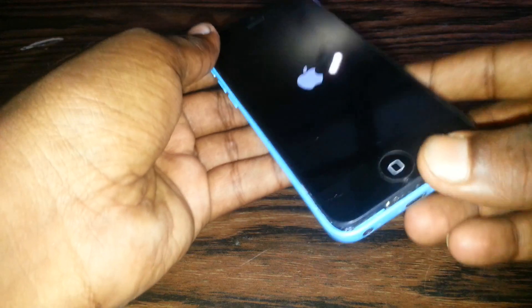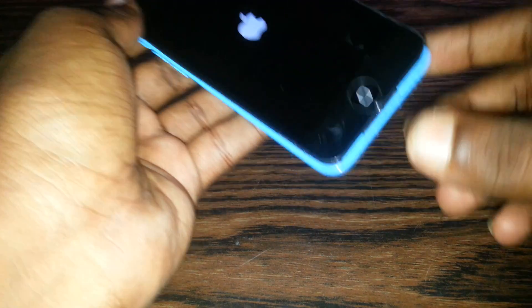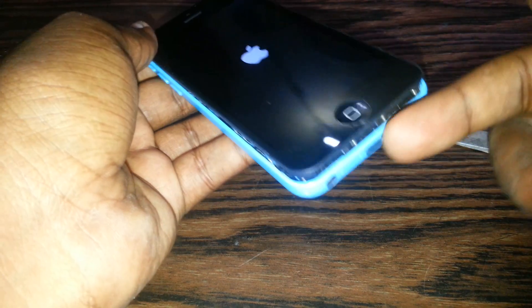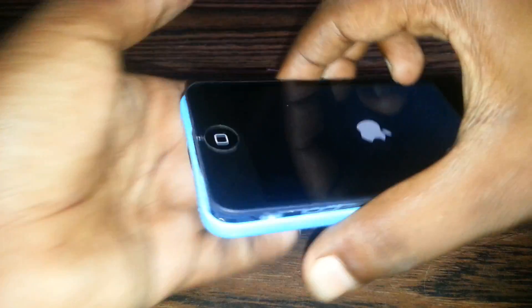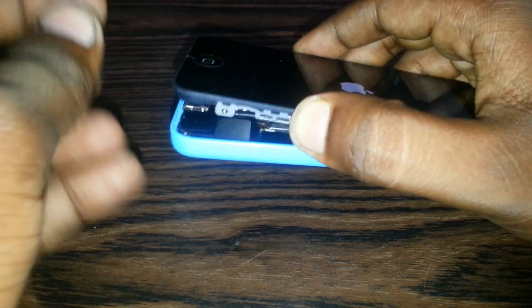Now it's on! It's very simple — you need to open the two screws, use a suction cup to press and give pressure, remove the touch and glass, and simply open the battery connector, then put it back. It will work.